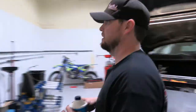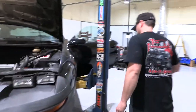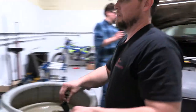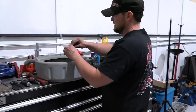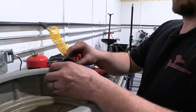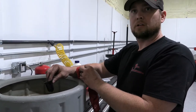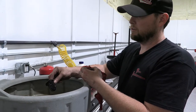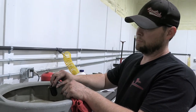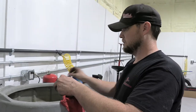Level the fluid to about halfway in the reservoir. When you put the cap back in there's a black rubber piece — drop it in, as it acts as the seal for the cap. If you fill the reservoir up too full, putting this piece in will displace enough fluid to overflow into your engine bay. So don't fill the reservoir much more than about half, so that when you insert this piece the level will rise up to the full position.